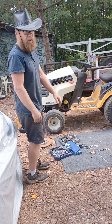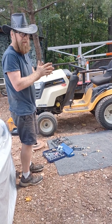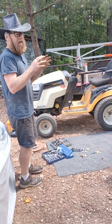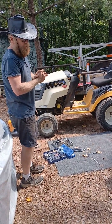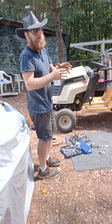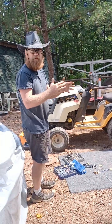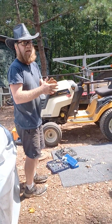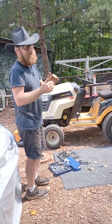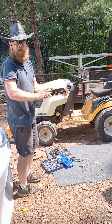This is an older mower that I had been able to obtain after the passing of a near relative. It's had its issues over time. If you're familiar with the Kohler Courage V-Twin engine coil issue, there's a conversion kit to return it to a previous generation coil pack. The older style is more reliable and requires a simple swap with a little bit of wiring clipping. The symptom was it was only running on one cylinder.